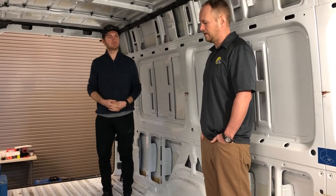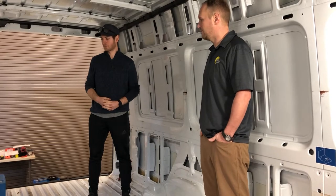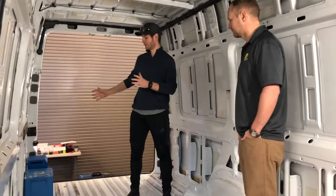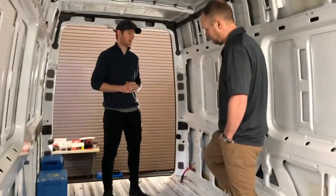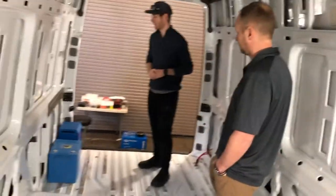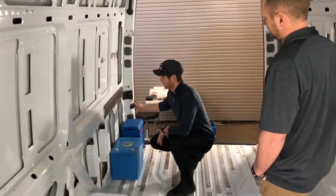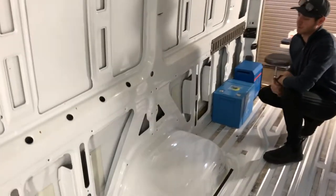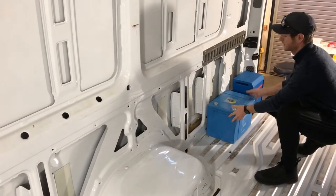Since this is a shell, how do you plan on securing the equipment and mounting things since they're eventually going to build out? Typically, we're going to look at this rear space — either the passenger or driver's side, depending on where the kitchen and rest of the van will be. The process is basically to build a piece of plywood that will mimic the shape of the van going over the wheel well. That gives us a build platform to mount most of the componentry to, as well as secure the batteries through that board.